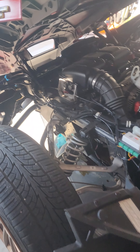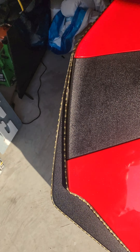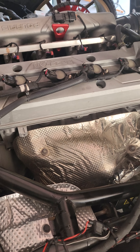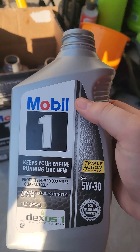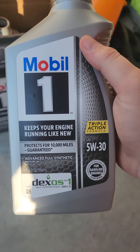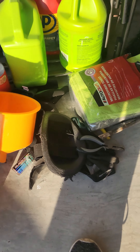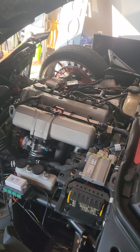To do a final walkthrough, make sure you go in and hand-tighten the filter, make sure the dipstick is good, and make sure the oil cap is on right-side up. Hopefully this helped. As for what type of oil I use — it's Mobil 1 5W30 Advanced Full Synthetic. I found this at Sam's Club; it was about $30 for 6 quarts. I'm keeping this extra quart to top off if needed. Subscribe and leave a comment if this helped you. Alright, see ya!